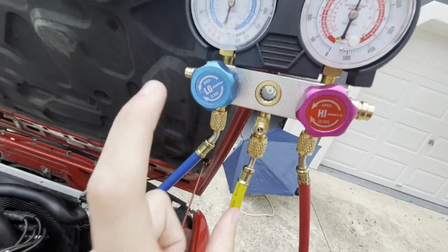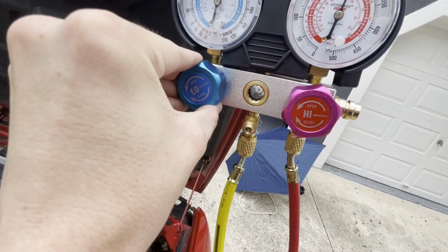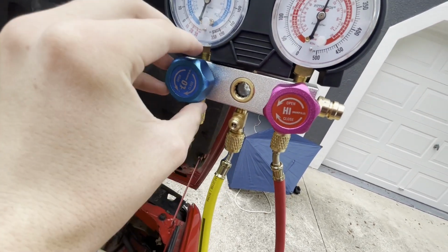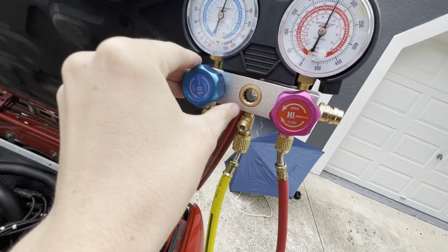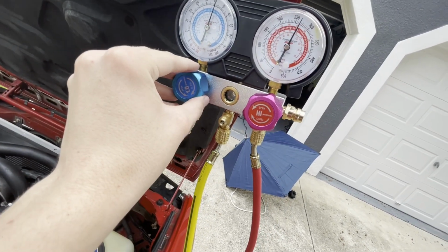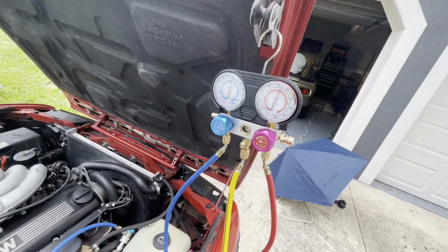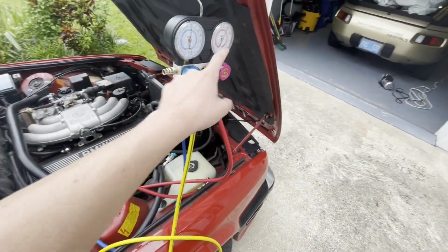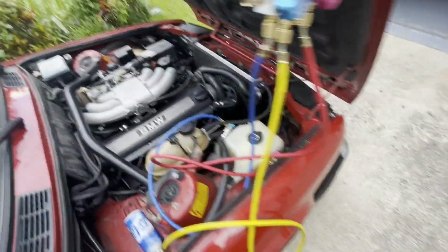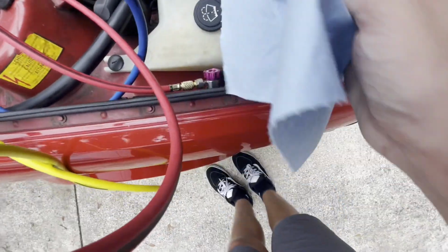Here's the sight glass. And the second can, apparently, since the compressor would already be on, you want to bleed the system. Slowly turn this. So I had it barely turned, stuff coming out. I'm going to turn it a little more, see if more stuff comes out. But I'll get that can in there. I should take the whole can and we should be good to go. Got that can emptied. Close this valve. This valve was already closed. I'll go in here, go here, close this valve.